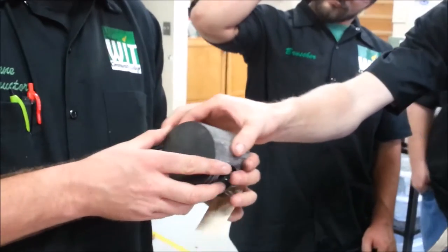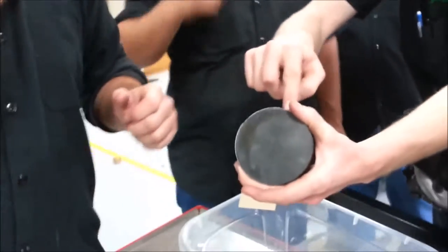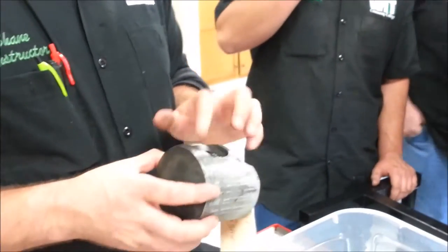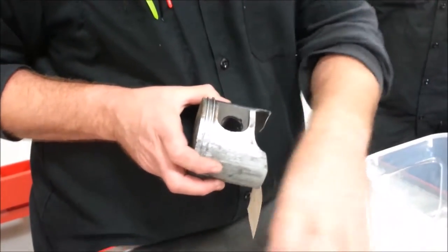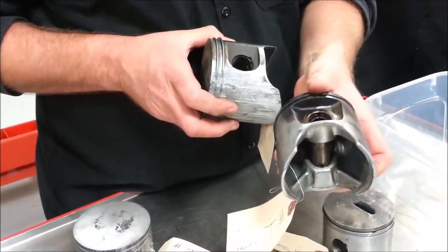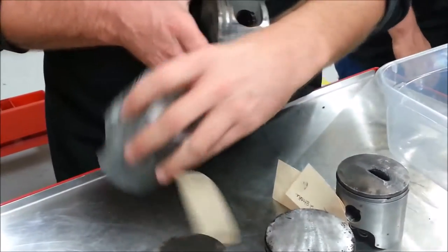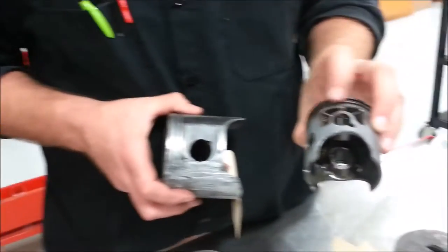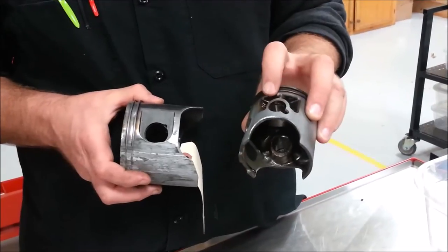On this piston — turn it. Why is this all cut out for the wristpin? Any time that they can get rid of an area. His question was why is this cut out versus how this one isn't — you look at how this one is cut out. You can see here there's going to be different shapes and sizes of these. Here's another one — you see how it's relieved there? They are very structural on where they put these reliefs in.